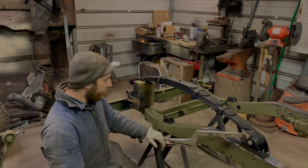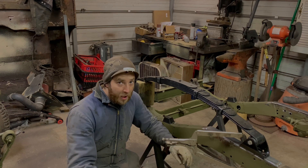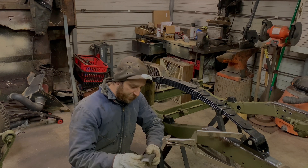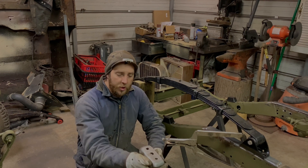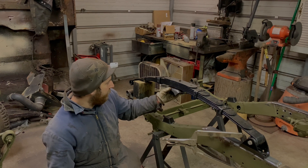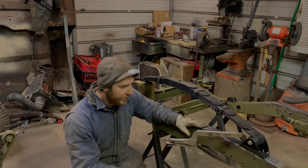It's going pretty well. My leaf springs are literally as far as you can push them — a quarter inch off the edge of the frame horns front and back. These are the biggest springs you can put in this thing without moving the axle perch. I bought ones with a three-hole arrangement so you can move it an inch forward or back. If it's trailing, it's pretty stable, though it can tend to fishtail, so make sure you've got good tight U-bolts. By using that I'm keeping within my wheelbase.